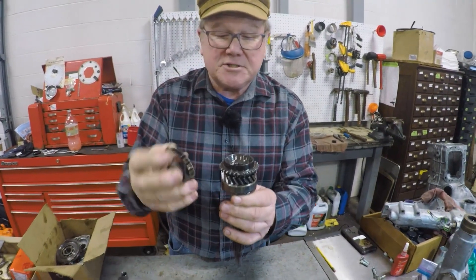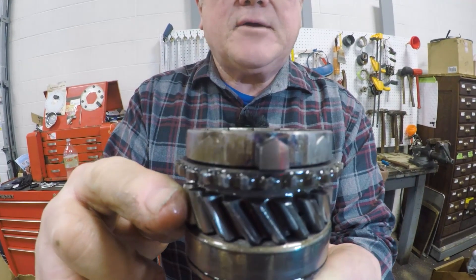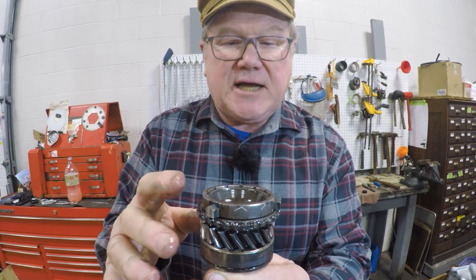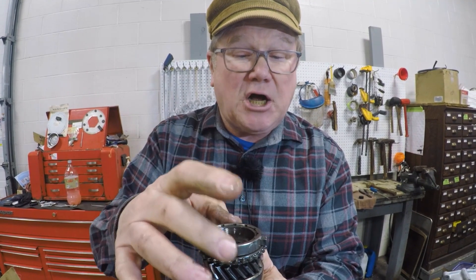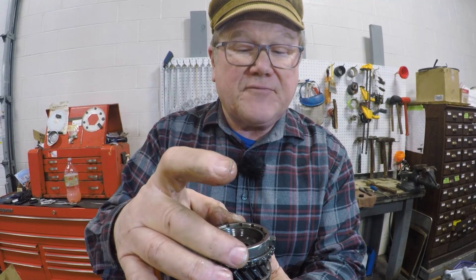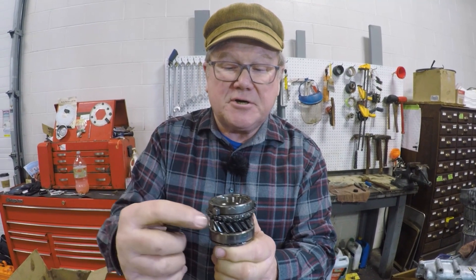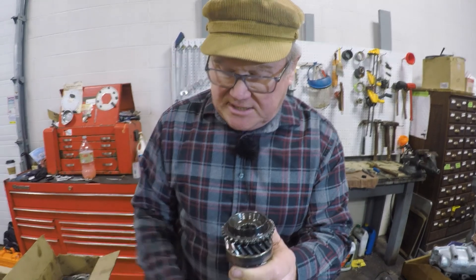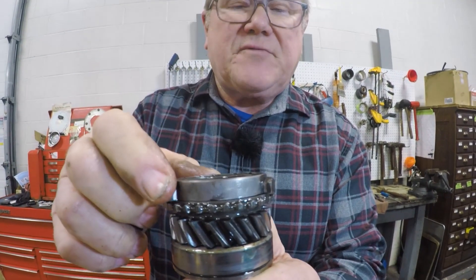Here are some better synchro rings. I'll put that on and you can see there's just a little bit of a gap there. We'd like to have about 60 thousandths of a gap. I've got brand new synchro rings that I just got in the mail from Bob Forsblom in Ohio, who does a lot of Spridget gearboxes. They'll stand even taller off the surface and the synchro will work better. You can get your feeler gauges out and measure it — it should be 60 thousandths. When it gets down to zero, there's no synchronizing that can possibly happen.